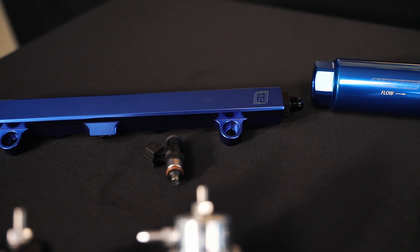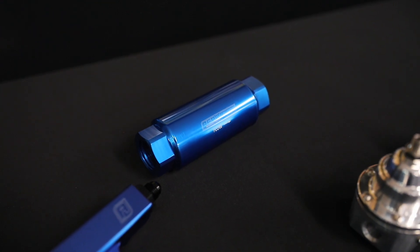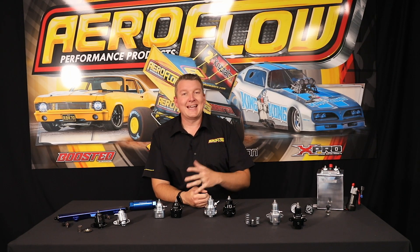When you've got electronic fuel injection and you're running injectors, you're generally talking a high-pressure fuel pump. Compared to a carbureted system, you're going to have quite a high demand for fuel pressure so that the injectors can operate accurately and correctly. In an aftermarket application you can be talking all the way up to something like 500 plus litres per hour from a fuel pump, and the pressure supplied can be quite high — upwards of 100 psi — which is well above what your injection system is going to run at. The injection system generally will run at 3 bar or 4 bar of fuel pressure, so you need to get that pressure back down using a fuel pressure regulator.